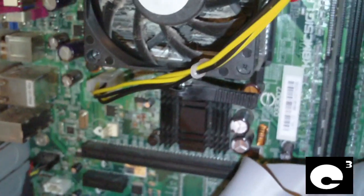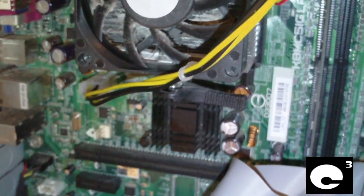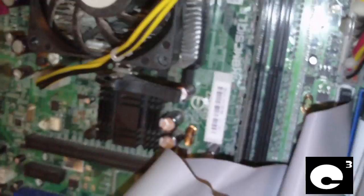So, what I'll definitely do to this motherboard before I put it into full service is take the Northbridge and Southbridge heatsinks off and get the pink stuff off, clean them up real good, and install some fresh thermal compound to the chips. That way this board here won't have to be reflowed sometime down the road. At least I hope not.